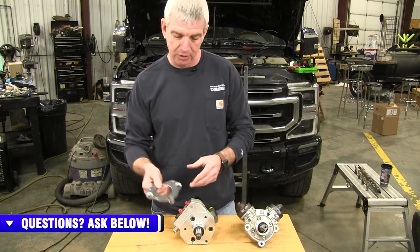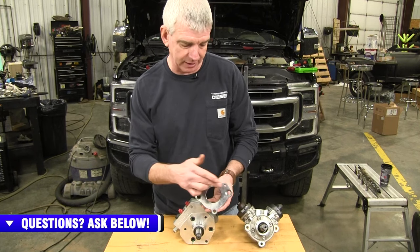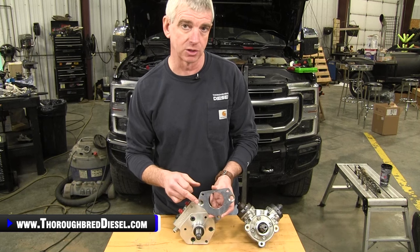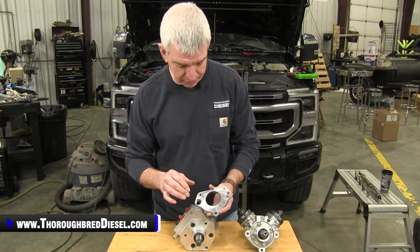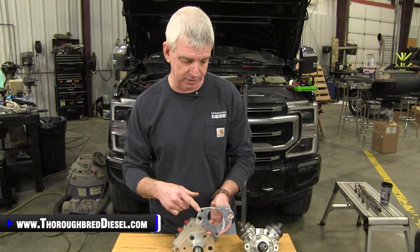So we will grab our mounting plate. This mounting plate, S&S came up with this. You've got countersunk holes here that are going to use the two threaded portions of the block, and bolts are included in that. And then we'll add two studs that S&S includes as well.